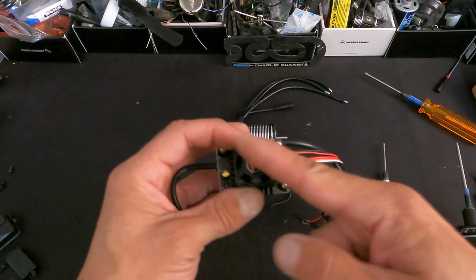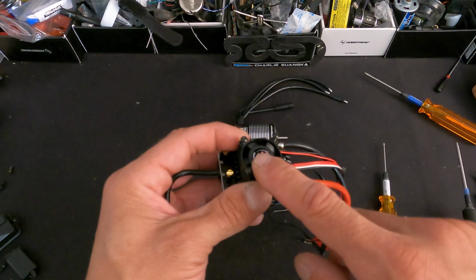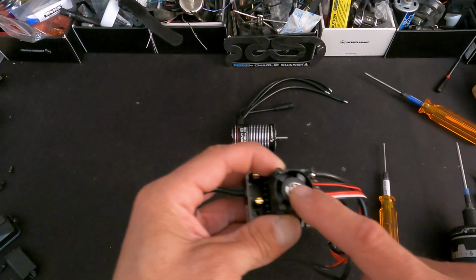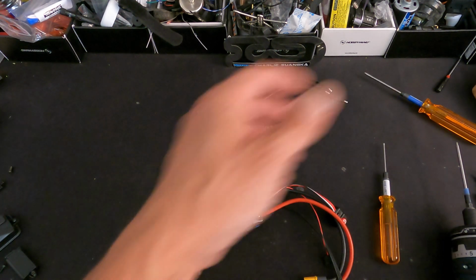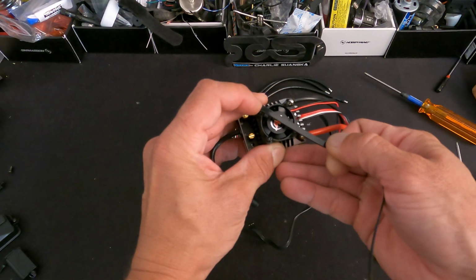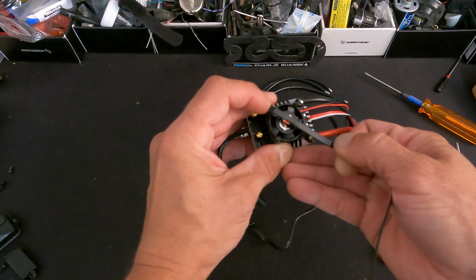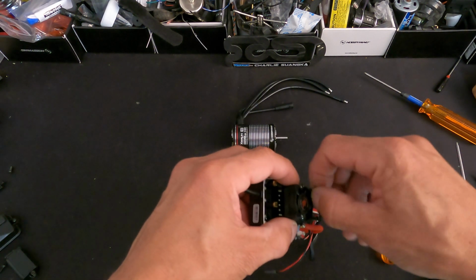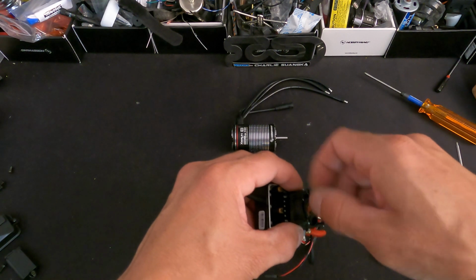Also, if you do retain the fan, you want to make a fan protector for it. If you crash upside down or something flops onto the fan, these blades can get broken pretty easily. So the easiest thing to do is to cut a section of zip tie and go diagonal across the two fan screws that hold it on. Drill 2 little holes in there, and then it helps the fan last forever. I bring that up a lot because people break fans.